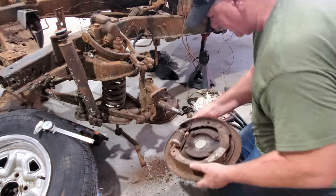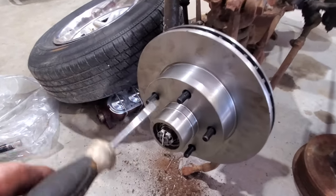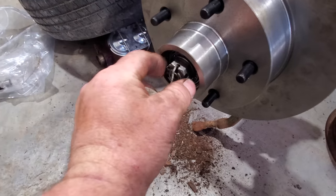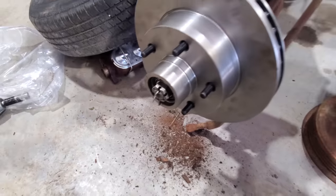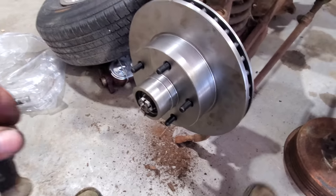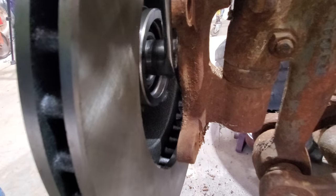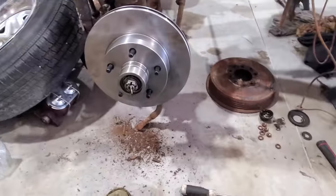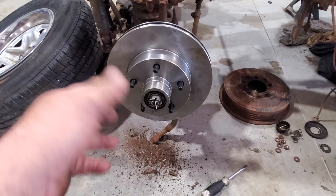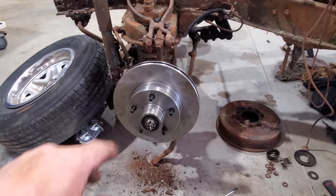I've got my measurements for my little adapter. Here's the rotor on the spindle. I've got the nut on it with the cotter pin — that's got to stay there. So what you do is come back here, and there's the bearing way in there, and there's the back of the spindle. The adapter is going to take all of that play out. Here's my new rotor assembly. You want to measure from the outside of the outer bearing to the outside of the inner bearing — the thickness of that bearing stack. Same thing over here, and what I got was basically an inch difference.